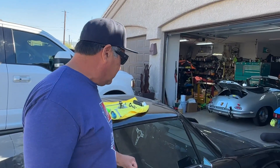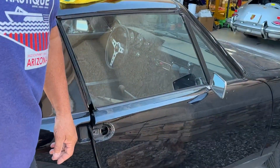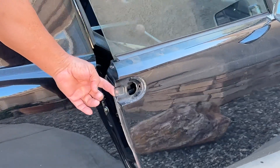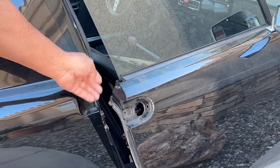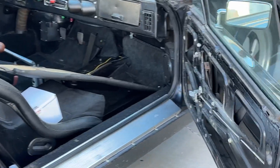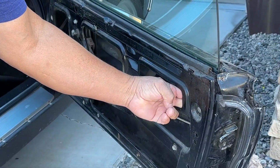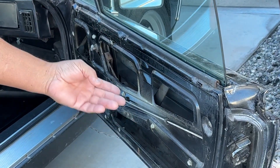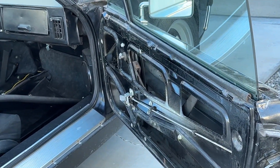So I'm going to show you what happens and I'm going to show you the fix, very quickly. To remove the door handle, you've got that bolt there from inside the door, this one here from inside the panel, up in here. You've got to remove the panel — I don't need to show you how to remove the panel, there's just screws on the handles. It's all self-explanatory.